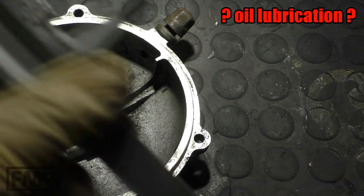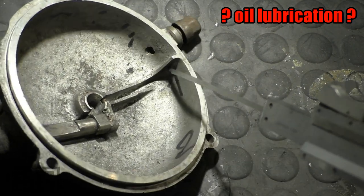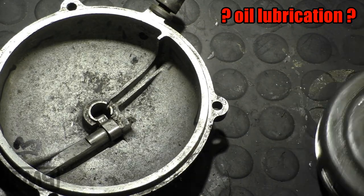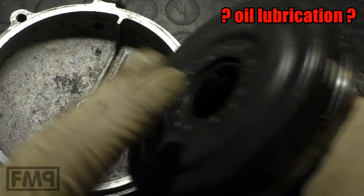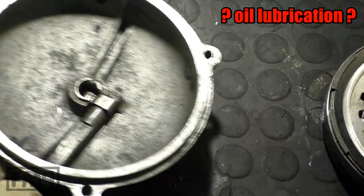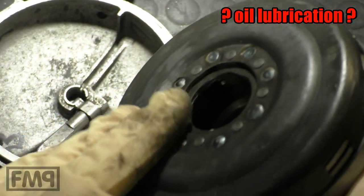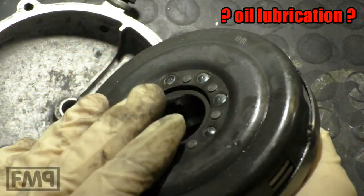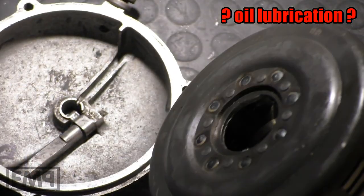A question on hand: will it influence the oil coming to the push rod? It looks like this is the channel for the oil to guide more oil here. It will not, because on the outside of the clutch there is no oil — there's just a little bit of oil fog dust sprayed in there. I usually do a grease test: I put grease all around here to check if it still makes contact. After many kilometers the grease is still there, meaning no oil is getting there to wash it away — just a little bit of fog coming from this side onto the clutch.